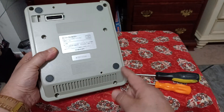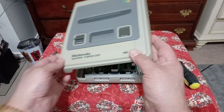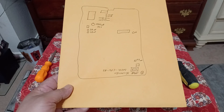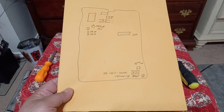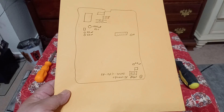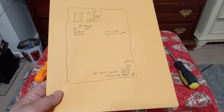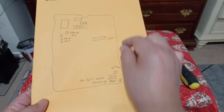Underneath we have six screws with the security bit. Remove those first. Once you remove the screws in the bottom you'll be able to take the top off. Then you can take a picture or draw a diagram. I drew a diagram and marked all the capacitors on it. Make a paper diagram so that once you take the board completely down you'll be able to mark where all the screws and capacitors go. I laid the screws on the paper where they go.